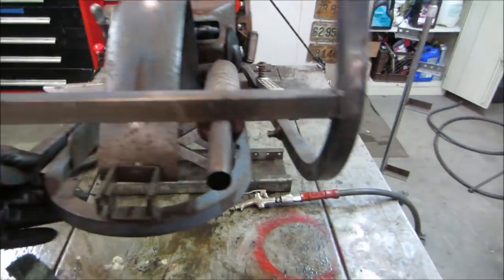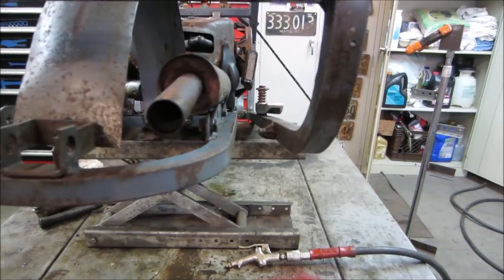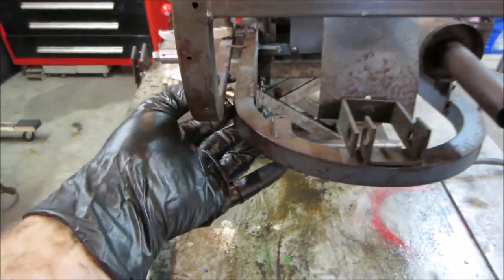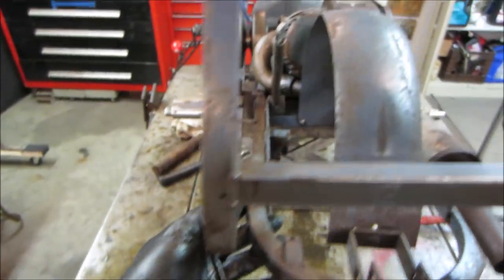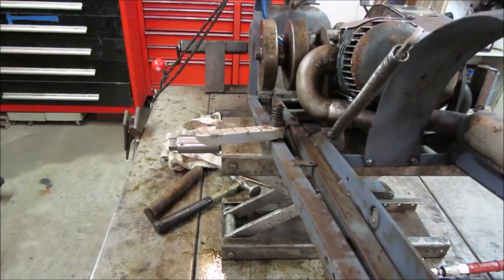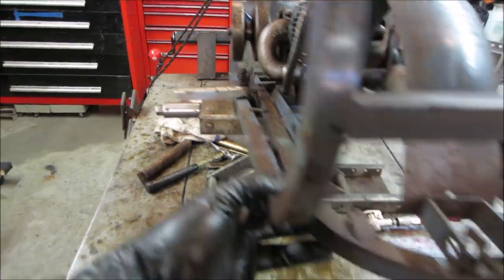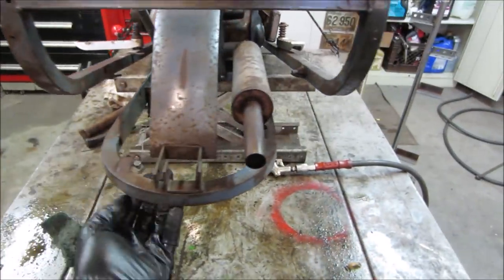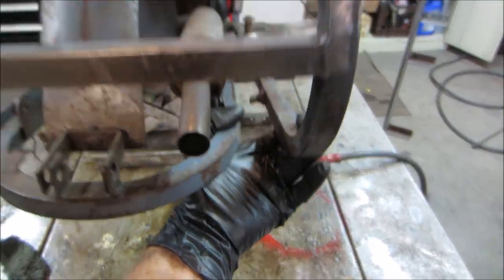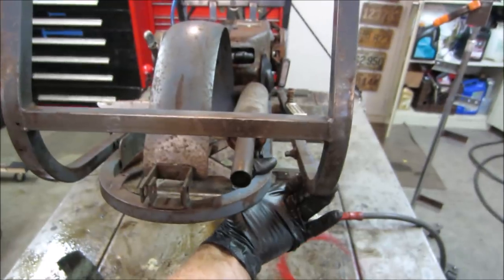But you could look at either side. Down at the end there, it's about an inch wide. And down here, it's about 2 inches wide. And on this side, it's almost touching. I don't know if you can see down up front there, it's a good inch and a half. So one of these is not like the other. So you've got to squeeze. I'm thinking it's the frame, because that swing axle is pretty tough.